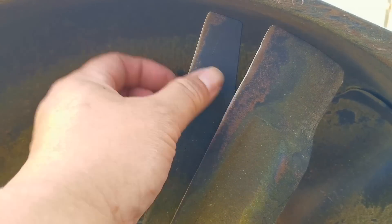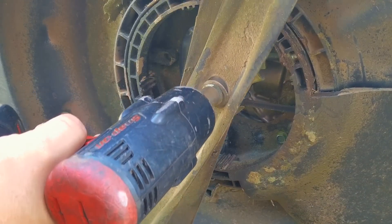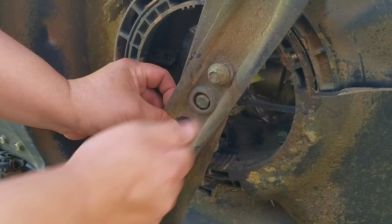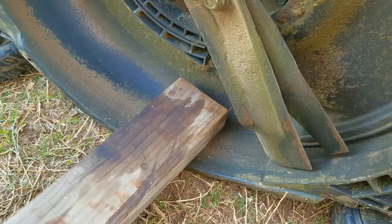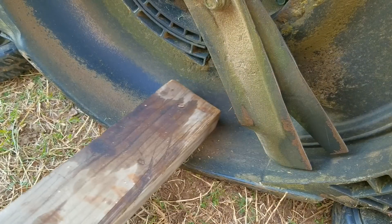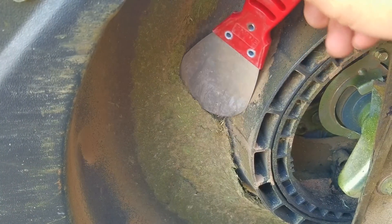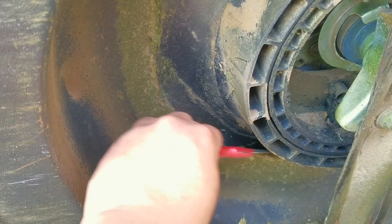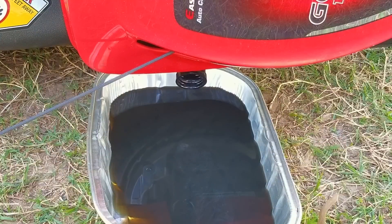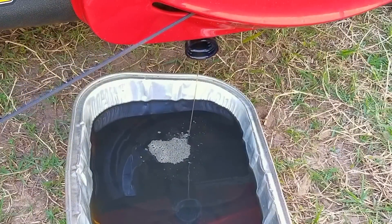They have a couple of trees in their front and backyard, which explains why there are a few small gouges on the edge of the blade. These blades aren't sharp anymore, so just to be nice I'm going to remove them so I can put an edge back on them. I don't show how I do this because I don't see any point showing me using a grinder — if and when I get a sharpening rig, then I'll consider showing how that works. The underside of the mowing deck is very clean, which makes sense seeing as how they only used it a handful of times last year, but there are a few clumps of grass stuck to the central part. To help improve how your mower cuts and mulches, try to keep the underside as clean as possible. It looks like the oil has stopped dripping, but I learned something new today: if I put the mower back on its wheels for a few seconds and then tip it over again, more oil will pour out. The first time I did this I had a couple of ounces of dirty oil come out, so I might have to do this trick more often.